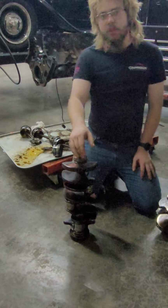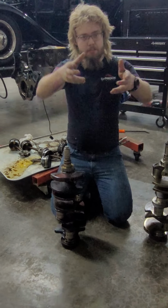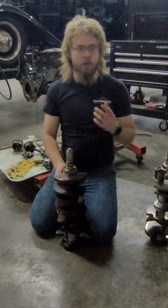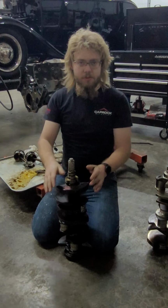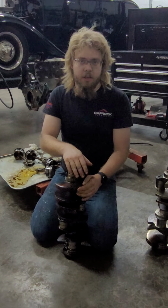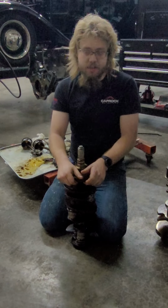For this forging, you have a big cubic mold, or rectangular, and you cast what's called a billet. You just cast a big brick of metal, or something roughly close to this shape. Then you take it to a forging press that uses dies, which are basically imprints of the crank, and you'll have 2 or 3 stages where one's rough, one's a little finer, and one's really close to the final product. You smash them with a massive, probably 100-ton press. Whereas this one, you just cut it away and it's all jumbled. Forging creates a nicer, very dense grain structure.